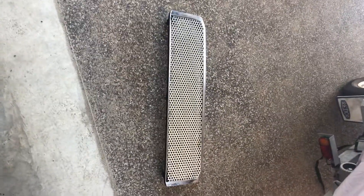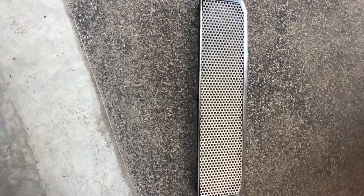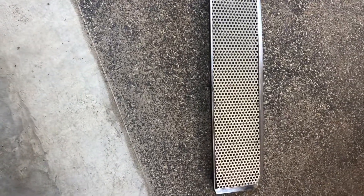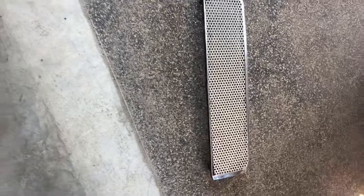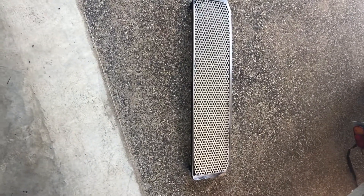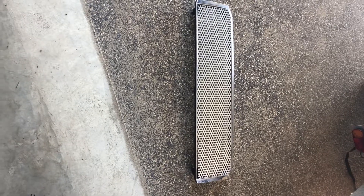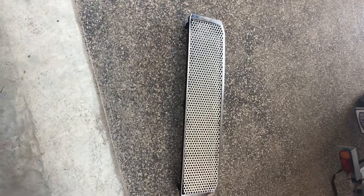The top part there is the top of the grille. I've just got to clean up the fabrication work, the welds that they've put in there for the fixing points, and give it a bit of a surface preparation. Then next week I'll be painting it with some Raptor 2K aerosol — it's a matte black finish — and once that's done I'll install the mesh insert into the grille surround.